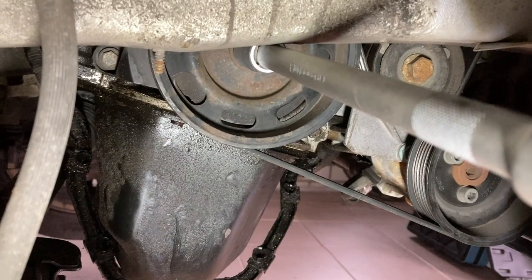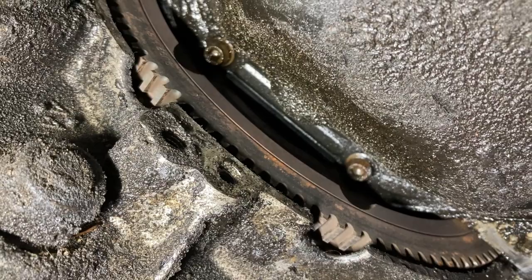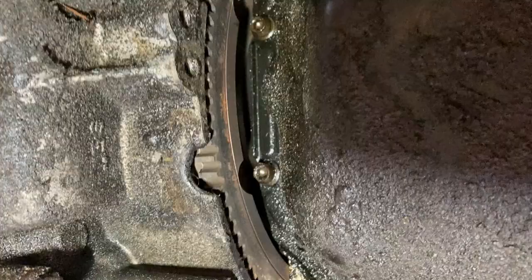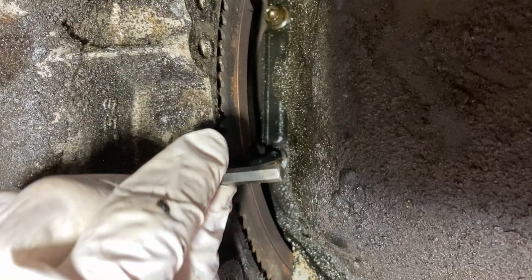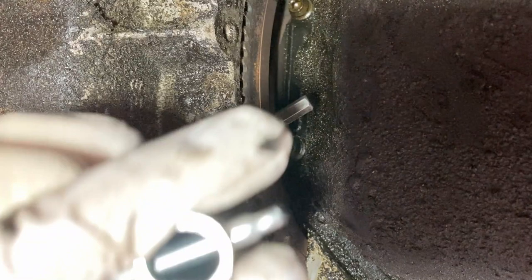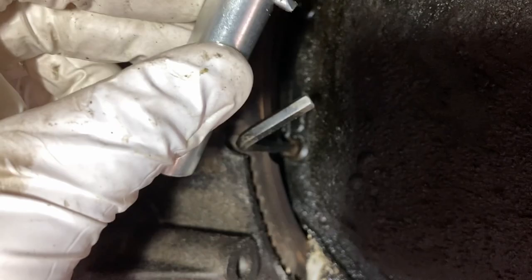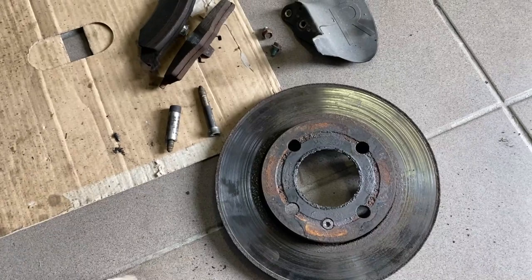There's just enough clearance to rotate our crankshaft a little bit, but I'd really recommend lowering the engine — which we'll do a little later. For now, just a little rotation. There are the two notches in the flywheel. I managed — the best option is a long allen key. I already loosened them. I was using a straight pipe from the top for some leverage, but it's not perfect because there is a torque requirement and you don't want a leak there.